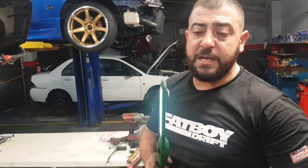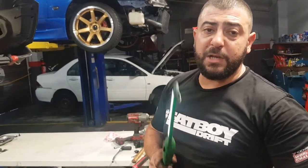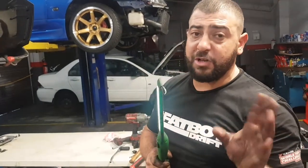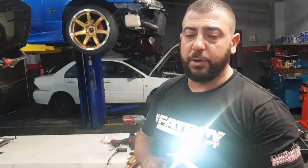not a mechanic. Replacing the chain, some chains that you buy do not have these yellow marks or the orange marks on there. So you're best off putting your own marks on there and following it back to basics. And some people come with the cam gears, they've got adjustable cam gears. That all comes back down to your tune-up and doing your cams as well.